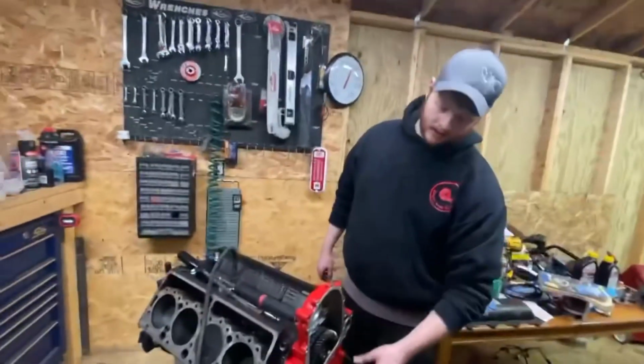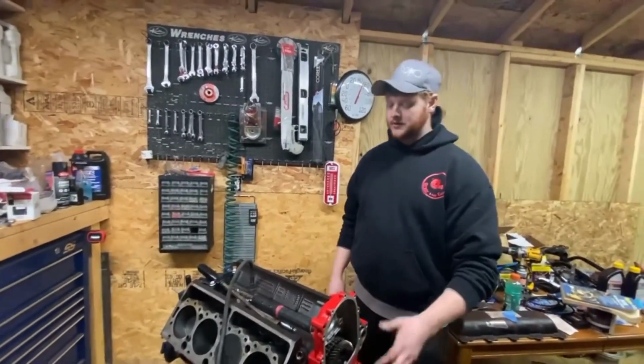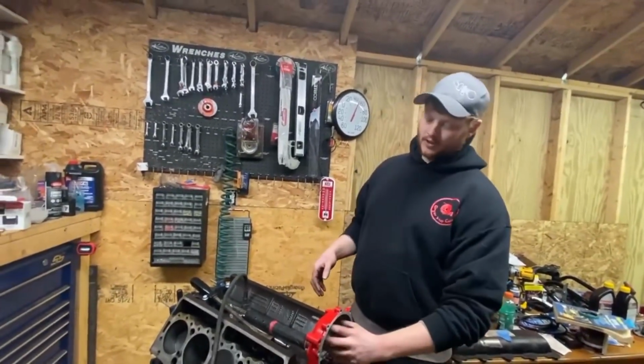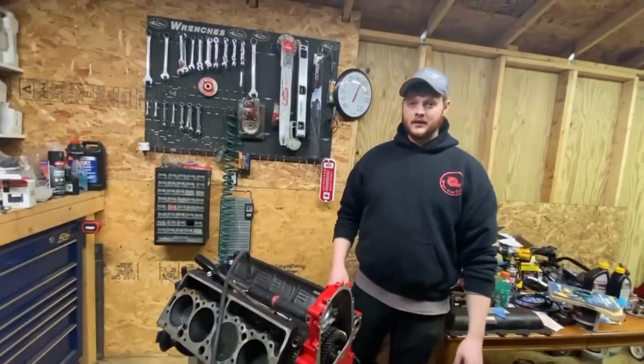After that, you can go ahead and put your water pump cover on and put your bolts all the rest of the way around and close it up. Now, if you're going to do this out of the truck, don't put the water pump on yet. That way you can put the injection pump on freely and you have more room to work. So here's our timing gear install, and thanks for watching, guys.